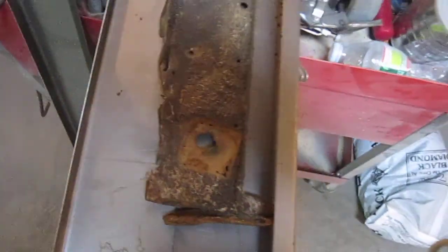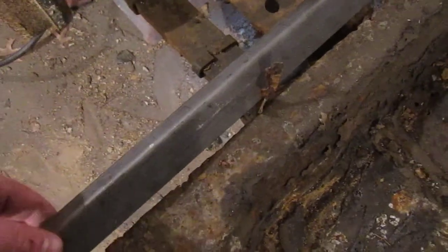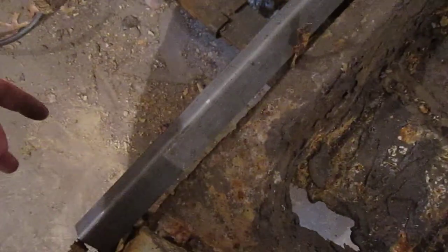There's the other rocker and this one is the other piece for the floor pan. The only rear sections I still need — and they're not even on the vehicle — I need to make these sections here, which are I forget, 14 inches long or something. They basically go over the rear lip, the channel — the four-inch channel, the main support beam. I'll have to make them or go back down and get them made. I didn't really know the measurement — I had it written down somewhere but didn't bring it to the steel place. I believe it goes down and has another bend, and that's where the three things meet.